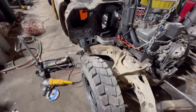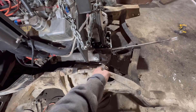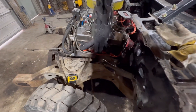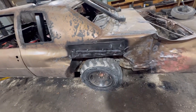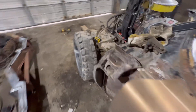Alright, so we got good steering clearance. Don't mind how the tunnel's done — we will be fixing that up a little bit, making it look pretty. We've got two and three quarter inches of steering clearance on the center link. Not sure if we should go a little further back and bring this pad all the way up. Motor's sitting pretty damn close, within an inch or so of where it's going to end up getting welded in. We've got good steering box clearance on the cradle, good clearance on the tranny and the tunnel. We're going to cut all these bolts off, tighten them down one more time, and then tomorrow we're going to bolt everything in where it's supposed to go, put a steering column in, and a front clip on.